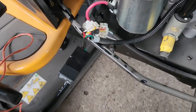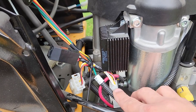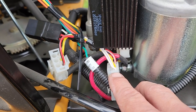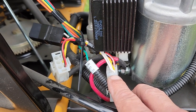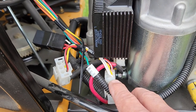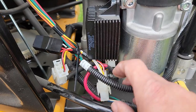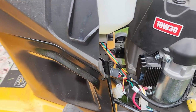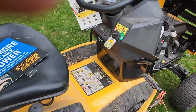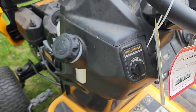That's definitely the problem. What I found was that these two white wires right here were loose. This entire time the lawn tractor has been sitting for years not running — it's just because of those loose wires. When I pressed them back into place — and I've since made sure they won't come out — that allowed the anti-backfire solenoid on the carburetor to open and close the way it should. Let me set the parking brake and turn the key.